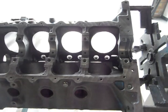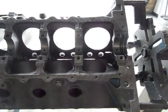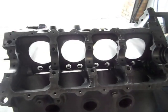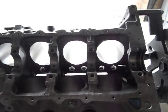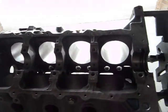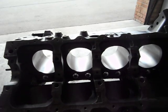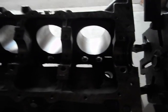I've put it up in another video. The Holdens have a bad reputation — they have a bad problem of wearing, prematurely wearing the camshafts, especially the back lobes. Just through years of mucking around with Holdens, I've sort of noticed that the lifter bores, the holes, the galleries that go through the main galleries, they're all uneven.